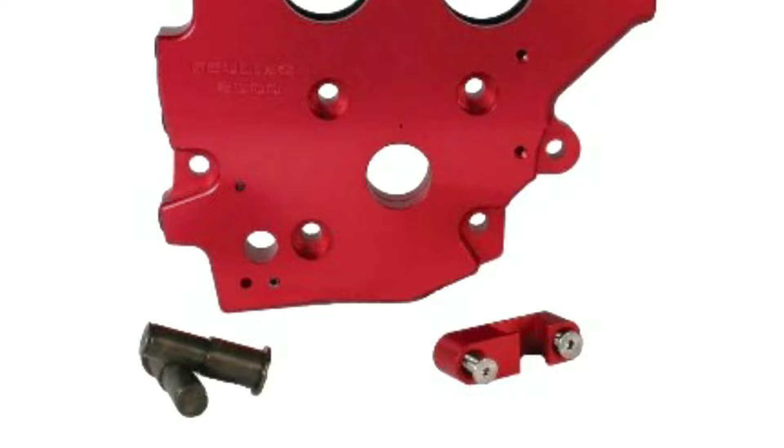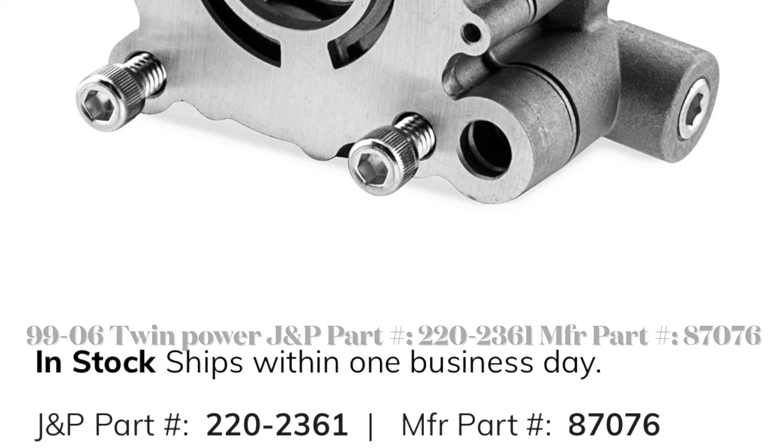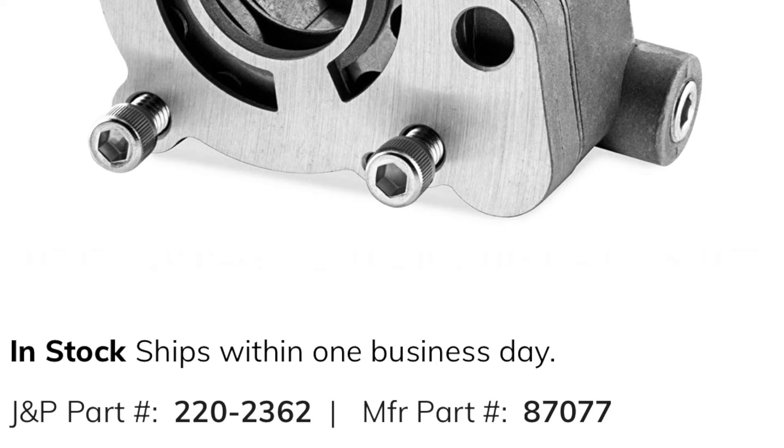Make sure the cam plate isn't bowed, which is extremely common on the sand-cast OEM plates. When you're just replacing shoes, even if you're on a budget, it's wise to check your oil pump gear rotors for wear and have one on standby for replacement. Most likely it'll be worn because its entire life has been riding on an out-of-true crankshaft. Better to replace a $150 oil pump than pay $250 and another $500 in labor to do it all over again.